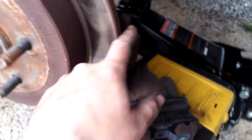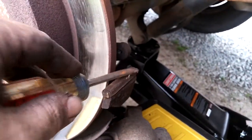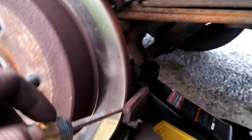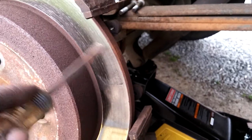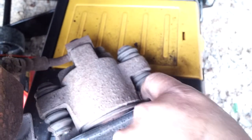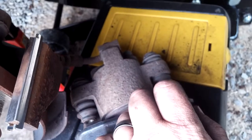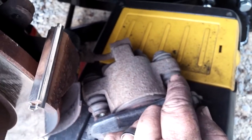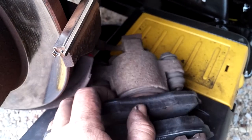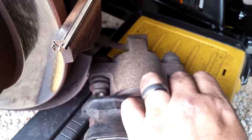Once you've got all that done, replace these little caps or clean them off and leave them on — I recommend putting the new ones on. When you pull these off, scrape all that rust out from under here with a wire brush, take some brake cleaner to all this stuff, and put a little bit of grease in there to keep it from rusting. Now it's also good to make sure where these little sliders are — that's where your slider bolts go, so it lets your caliper move back and forth. Make sure they move easily and they've got suction. You can take a greasing needle, like a syringe, pick it up at CarQuest, slap it onto the end of a grease gun, and squirt grease right in behind there. If these things lock up you're done — you'll need a new caliper or you'll have to drill them out.